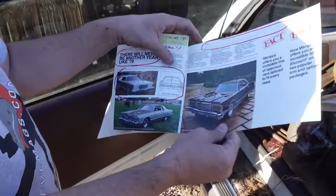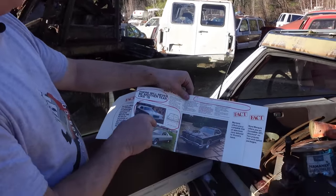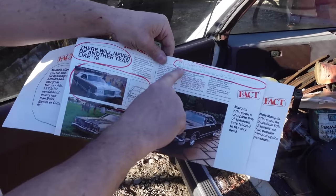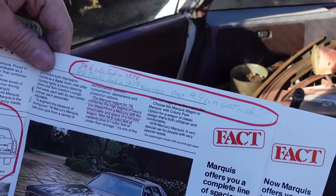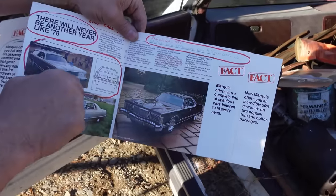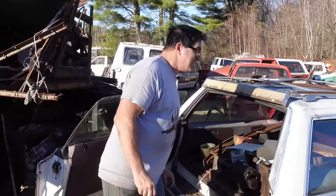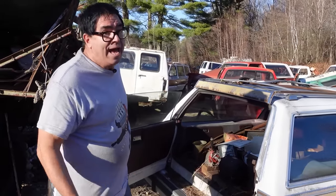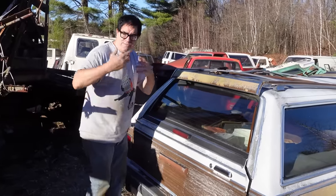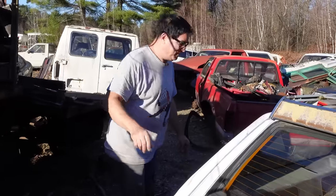SUVs came back and we started all over again. Here's the irony: this big car had 94.6 cubic feet of cargo capacity versus 89.7 — only 4.9 cubic feet less in the downsized '79. The larger cars were kind of bloated road-hugging weight that wasn't necessary, so the downsized cars were about as capable. The only downside was that the 400, 429, and 460 big blocks were gone — these were strictly 351 or 302.